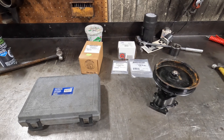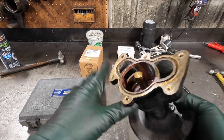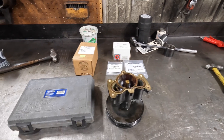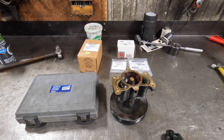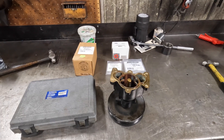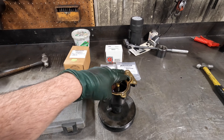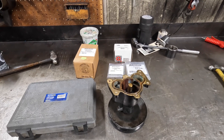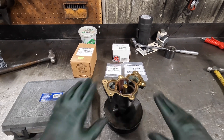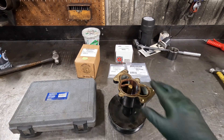Today I want to show you how we rebuild these Mercury water pumps. This style is very rebuildable and 99% of the time it's very expensive. It showed up on the 8.1 in 2001 on MerCruiser and progressed from there — ending up on 350 and 6.2s, inboard Bravo, and some alphas on closed-cooled models. This is a very popular pump; if you've ever had to buy one, you've paid probably $700 to $1,000.